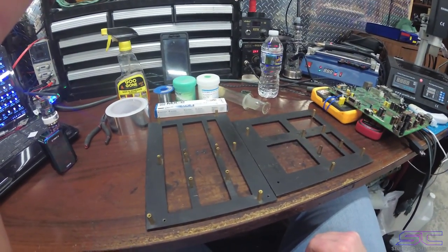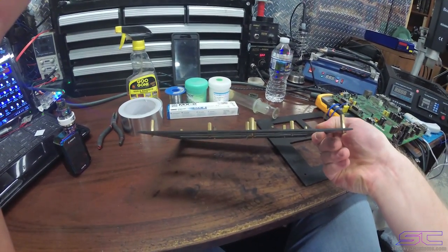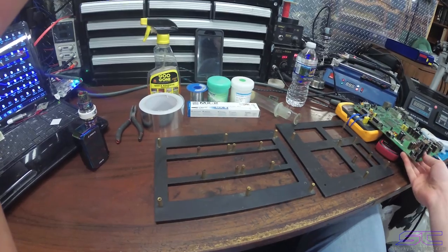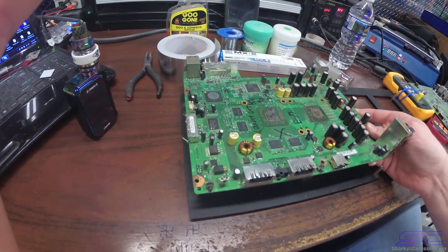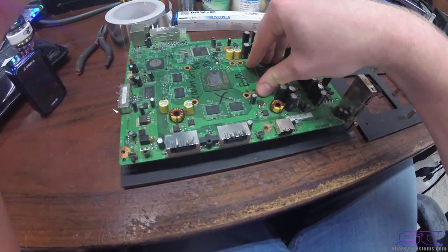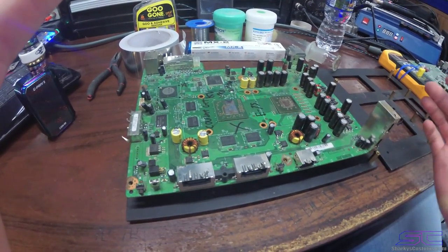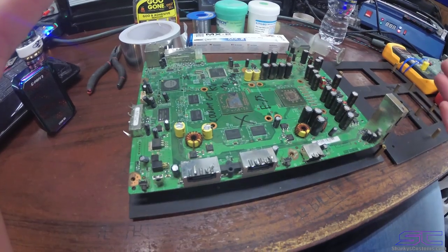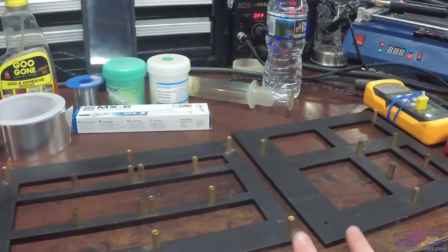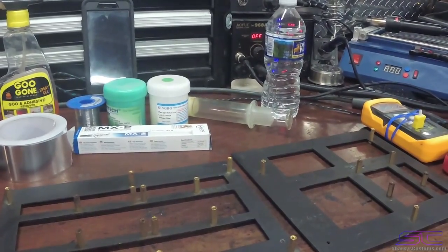So let's talk about what these big black things are. These are called jigs. Now, I'm not really sure what they're made out of, but they're really solid, so it'll be hard to bend these, and that's what you want. You want a completely flat thing. Basically, you put your Xbox motherboard on there, and you screw it in to hold it flat. The reason you do this is because when you're reflowing, it gets hot, and if you don't have anything to hold it in place, it's going to warp and the board is going to bend, and you just don't want that to happen. So the link to these two will be in the description, and you can also get them for PS4s and Xbox Ones, I think.